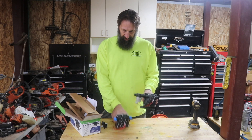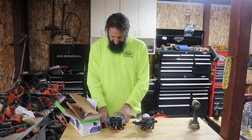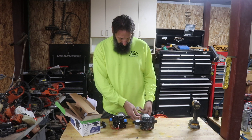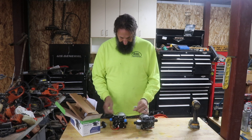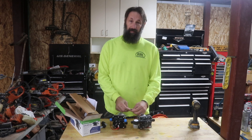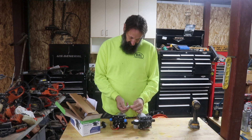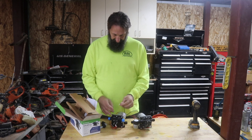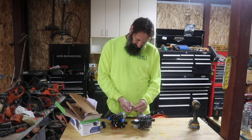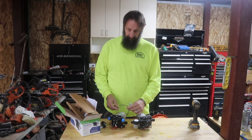The pumps aren't much different — they are the same pumps. We've got to take this piece off and move it over to the new one. The wires are not in a harness, so I'll have to take this piece off and wire it in. I'm probably just going to use wire nuts as opposed to cutting into the harness since it's probably already crimped down. Then this will plug and play fairly easy. I'm not happy about the wiring harness not being on it, but they're probably different on different vehicles.